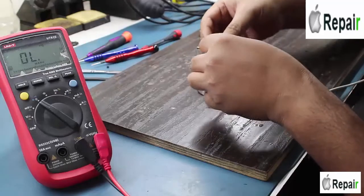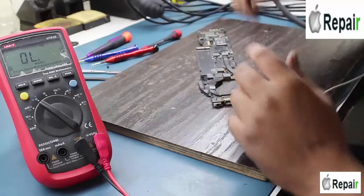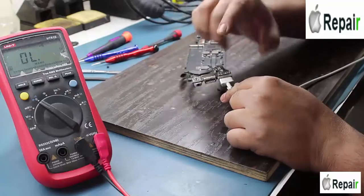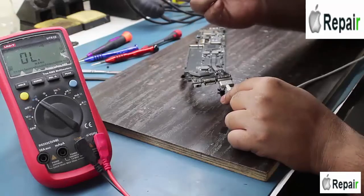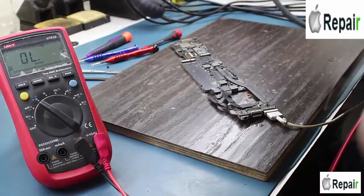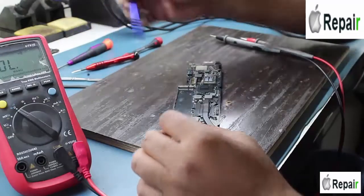Let's plug it in. When I received the laptop it was already dead. The condition of the motherboard is still the same — the green light is turning into orange, the same thing was happening. I removed the shorting from this capacitor but the condition remains the same. It is not turning on.